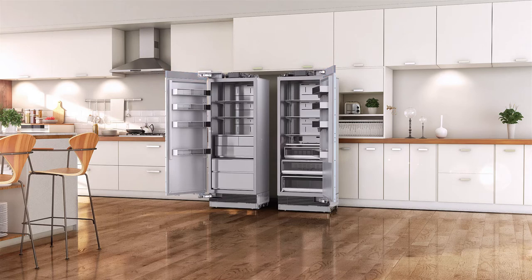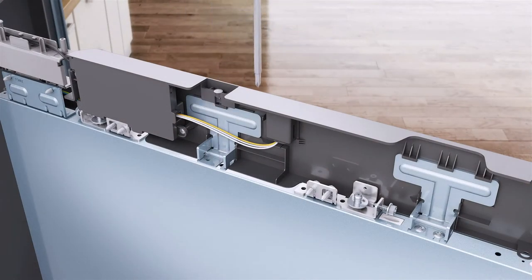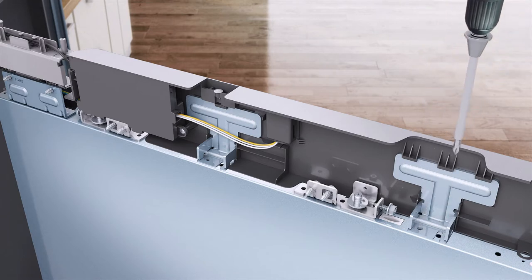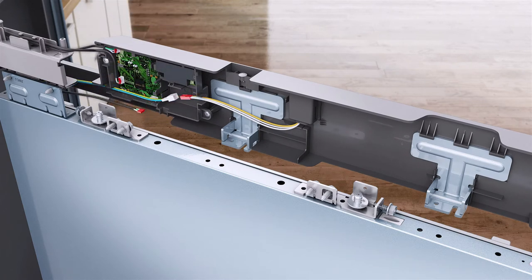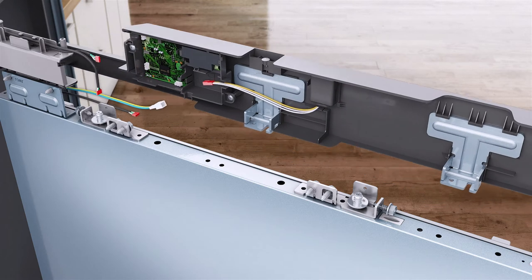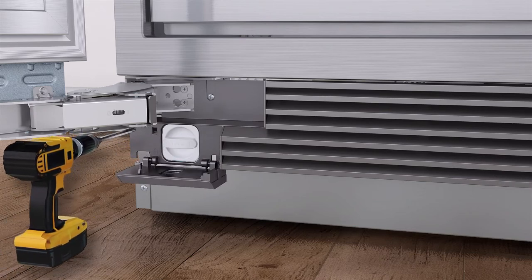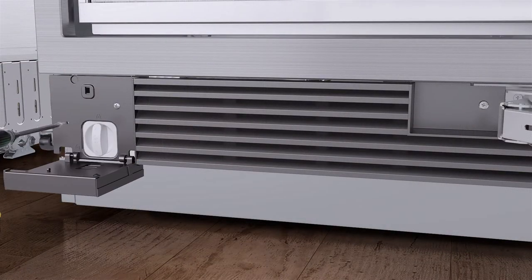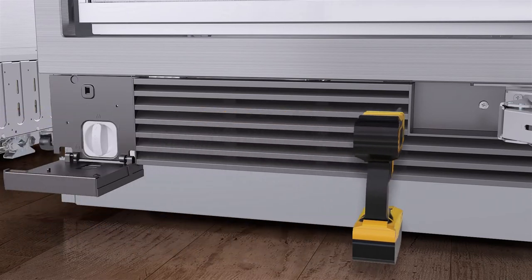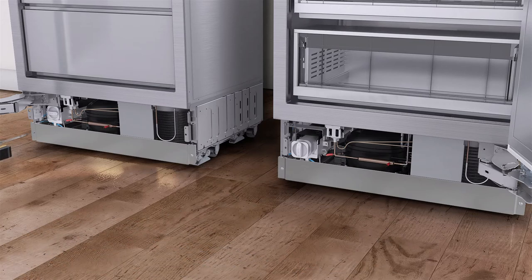Application pre-installation. You need to remove the upper door cap and kick plate before adjusting the custom door panel. Remove the upper door cover by removing the four screws fixing the cap door. Remove the Wi-Fi module cover on the inside of the cap door, then disconnect the housing connectors to separate the upper door cover. Remove the grill — in case of freezer, loosen two screws; for the fridge, loosen three screws to remove the grill. Remove the kick plate by removing the screws on both sides.